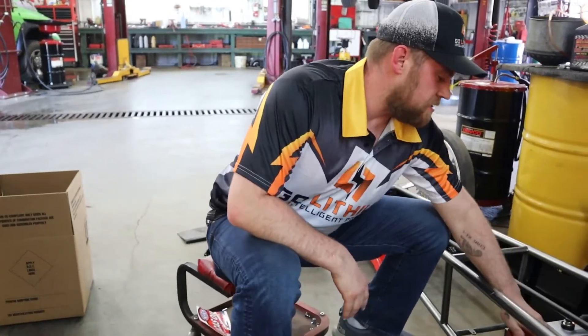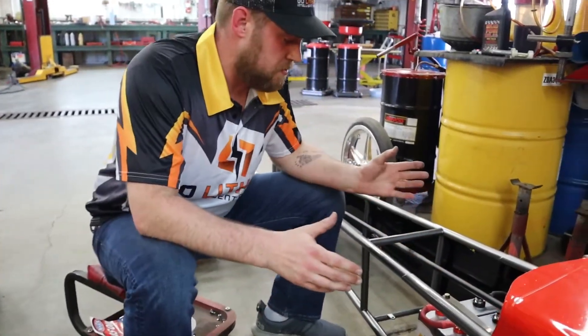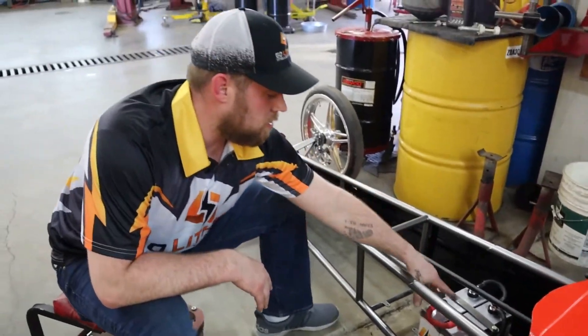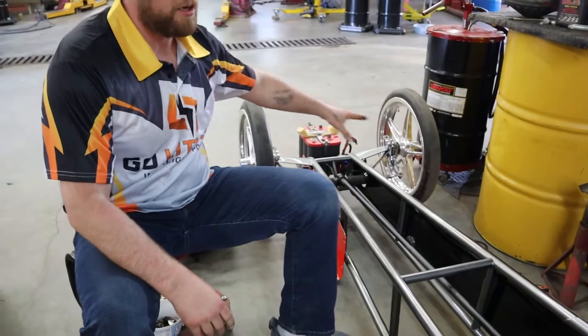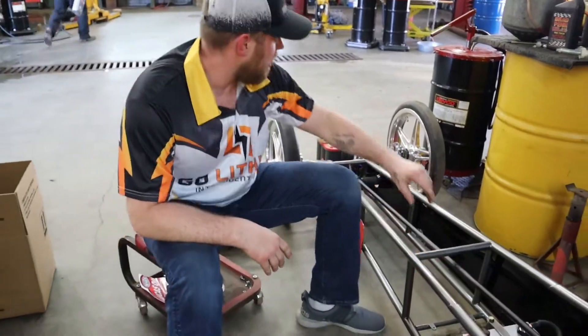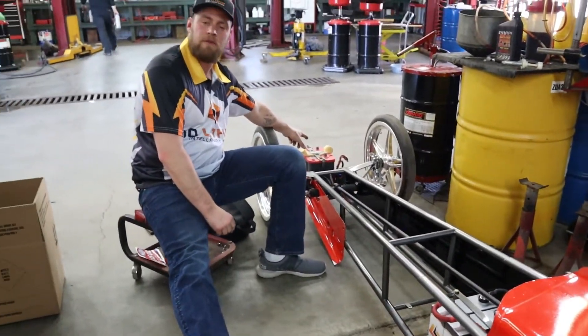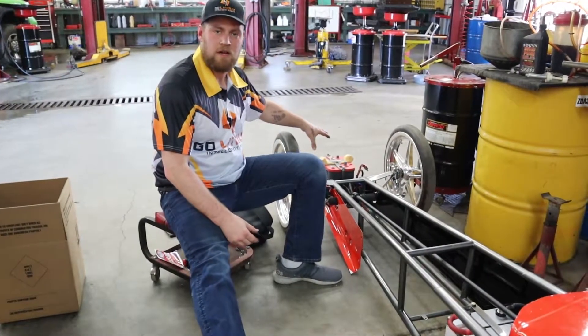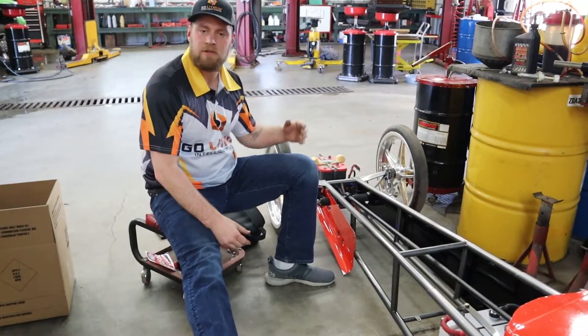Alright, we just got done putting the batteries in — it was actually an easy job. Pretty much everything was already set and ready to go, all we had to do was bolt it up. We put two of the Go Lithiums here in the center instead of one lead acid here and one lead acid here. That way now Chris can take this and put his lead puck here and whatever weight he wants, he can put exactly that in the front. Without that you don't really have many options.